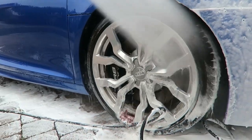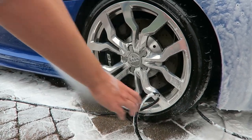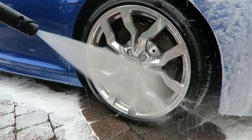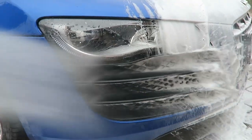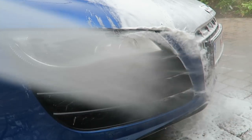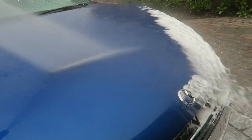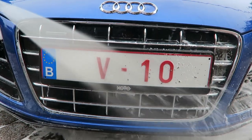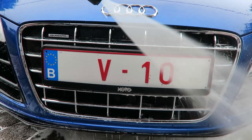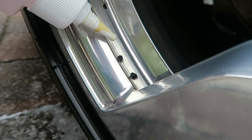I rinsed the entirety of the car. As you can see on the wheels, all the dirt comes off together with the iron remover that goes purple. Most of the dirt of the car comes off as well — you'll see a shot on the front number plate where just most of the bugs and loose debris will come off. So when we go to contact washing, this dirt isn't between the wash mitt and the actual paint, so it won't scratch.